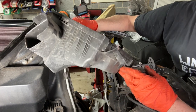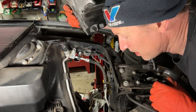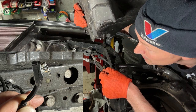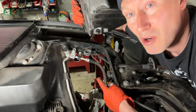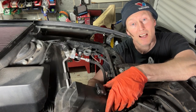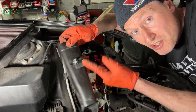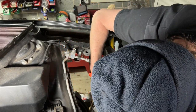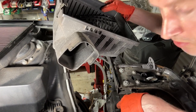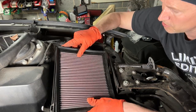Now I should be able to lift out this bottom box. I can see what's going on and why it's so loose - there should be a post that fits down into a rubber grommet and it's smashed off. Everything else under here is looking okay, although there is one wire where the fitting on the end is all crushed - it looks like it used to have a switch on it or something. It slides from the inside going towards the front and you just have to look out for a metal tab underneath which slides into there as it goes in. You can see how this is cut out into a half shape - it's because the bottom half sits down on that little piece we just fitted. So I just drop the filter back in.